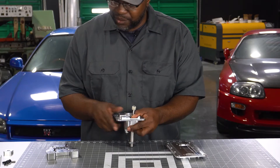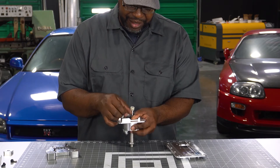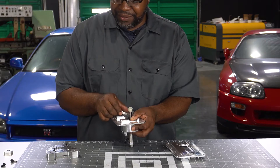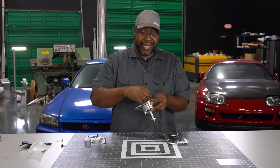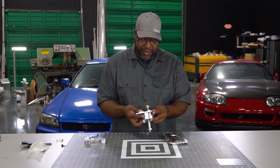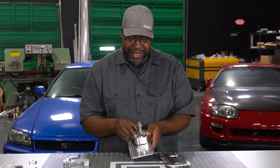Hardware-wise, you're going to have two different length bolts for assembly on the rear mounts. When you flip it over, you'll see one set is set up high and the other set is actually much deeper, which is why you have two different bolts. I definitely recommend that once you do a function test — meaning once you get all the gear selections working — go ahead and remove the bolts that hold the hat on to the base and snug them up with a little bit of Loctite. A little bit goes a long way and that should secure you for further use.